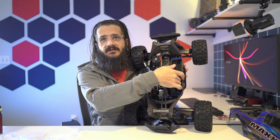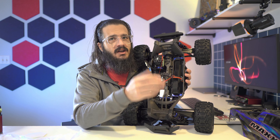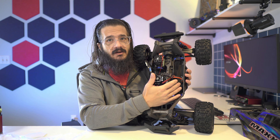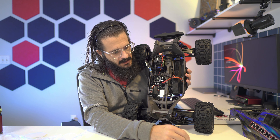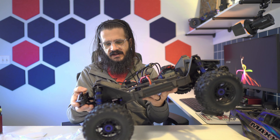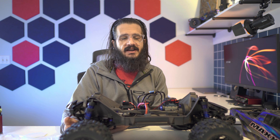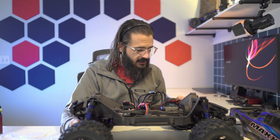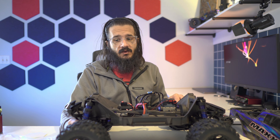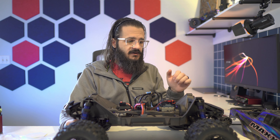The Hot Racing battery mount just bolts right in here and it's got a piece of Velcro in here. I'll probably add a cross-member strap — I don't think the Velcro alone is going to be enough to hold a decent-sized battery down. So I'll probably add a cross strap, maybe two. I do enjoy the setup and the workability on it — it is really easy to work on. I never had any issues with the plastic drive shafts. The sledgehammer tires have held up pretty well — no tearing. I did vent them right away, and I attribute a lot of my not having tire issues to venting. I vent the outsides of the tires and I do have a video on that.